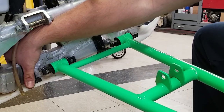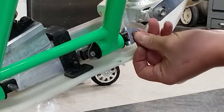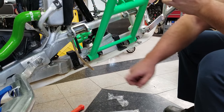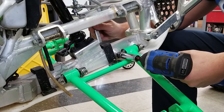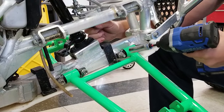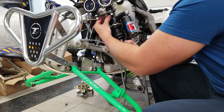A little tricky getting these in place - you put our retainers in place, these things kind of press on the seals. You could probably let these A-arms sag to the ground but the skid plate is going to block it from going down any further, so that's why I've got to hold it up. Now typically you don't tighten suspension components until the bike is on the ground, but I foresee this being a tight situation so I'm going to tighten them right now. These get torqued to 27 foot pounds. Lower arms went on pretty easy - let's get this Rocketron suspension in place.